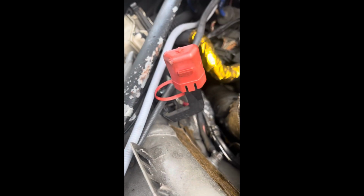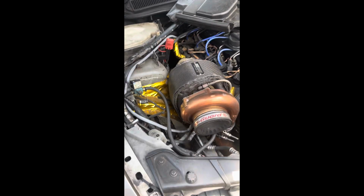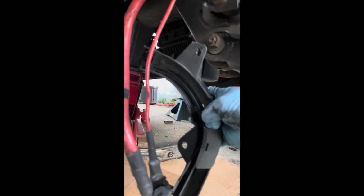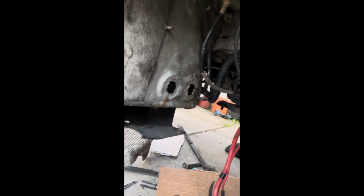So those 2 wires at the front go to there, which is on the other side of this. Nice BMW for making my day a living hell. Thank you. So to get it through, easiest way, I took off the bracket, the rear bracket. I'm gonna put it back on because I like my car OEM spec, but put the bracket back on, got the wire all the way through. I'm gonna put it up through the hole, and the rear end is done. Now then I can put everything back up. Subframe, gas tank, all of that.